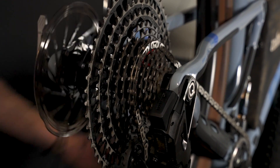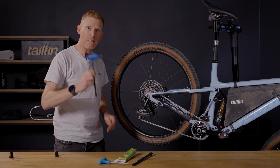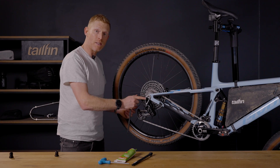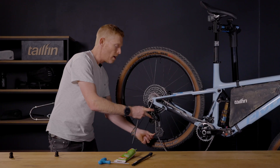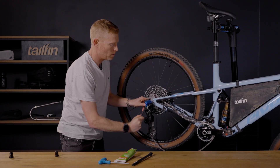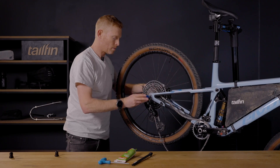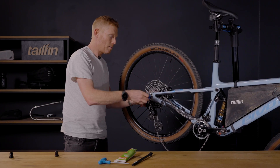First step is to shift the chain into the red setup gear as per SRAM's instructions — there's a link to SRAM's setup video in the description below if you need extra help. Then take your 8mm hex key and remove the inner bolt from the derailleur. When you start loosening this bolt you might find the derailleur moves forwards, so it's important to take the tension off the chain by pushing the cage forward and pressing the red button to hold it in place. When you remove this, the derailleur might move but it won't go anywhere.